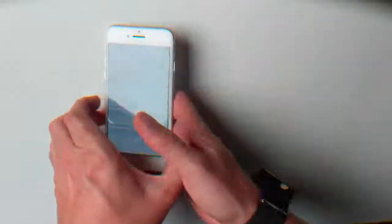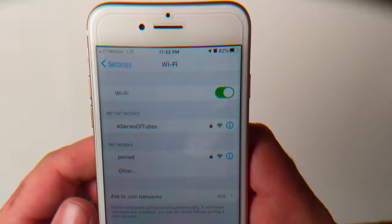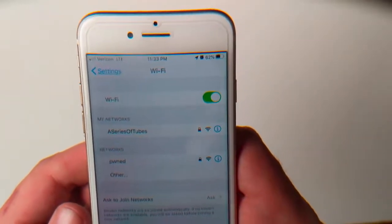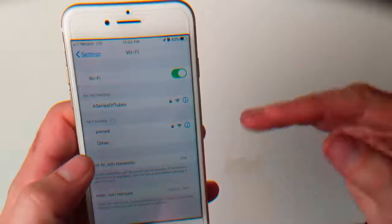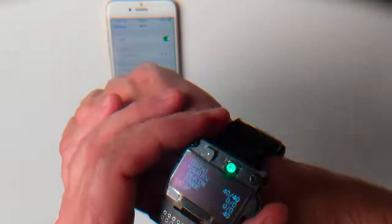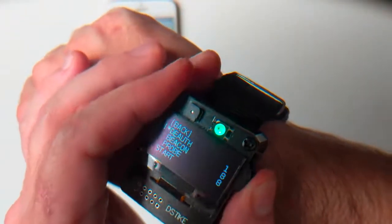We'll click Start, and what you'll see is this Wi-Fi will get D-Auth'd, reconnect, and D-Auth again. You'll see it happen three times quickly, and then it just stops trying to reconnect and reverts back to LTE. That's an iPhone thing — an Android phone would continually keep trying to reconnect and not give up.